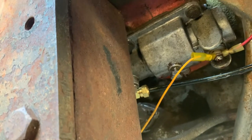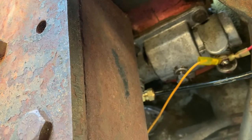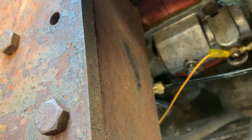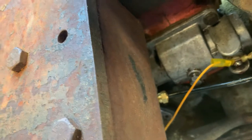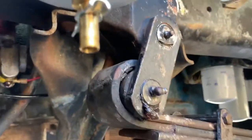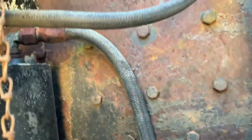I've warmed up the truck, got the transmission all warmed up. Tried to engage it following the directions on the visor in the truck. There are clear instructions on how to engage it, but it's not engaging and the light's not coming on. So I think there's maybe some wiring issue on the solenoid or maybe the pressure switch.